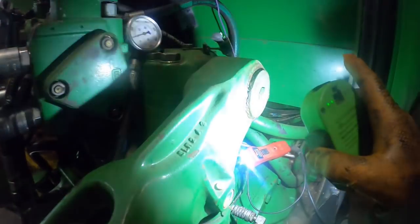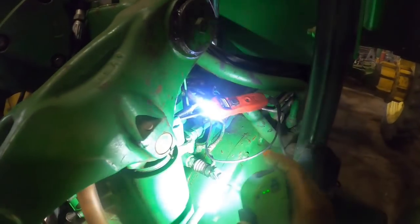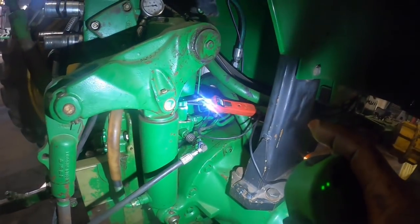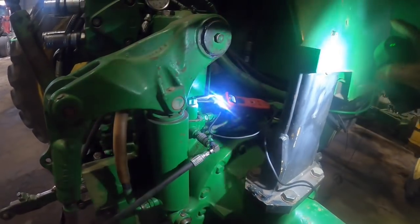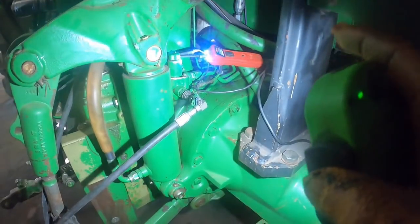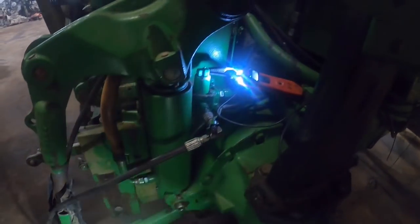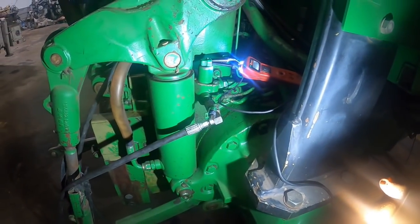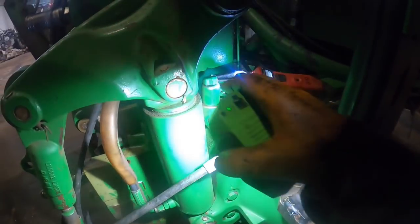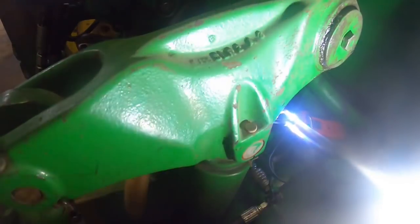But there's still something wrong with the button or the wiring going to it — I'm only getting nine volts. I've got a good ground on it, it's got a constant ground and then it's a power switched from the button. Something is going on from either the button or the wiring because I'm only getting nine volts, but it doesn't ever change. You can sit there with your power probe on the positive side of that plug and it never changes. I've got my power probe rigged up and you can actually hear the solenoid valve click.